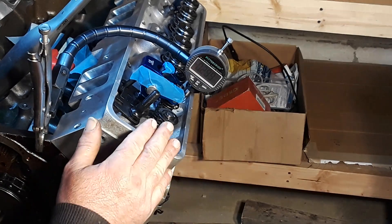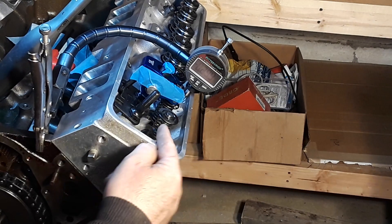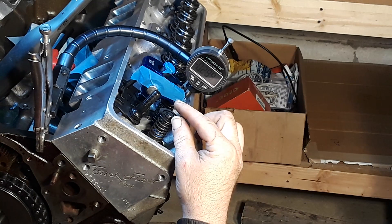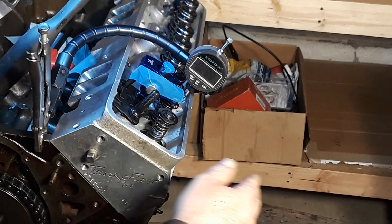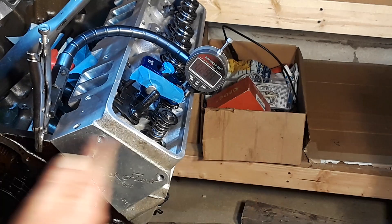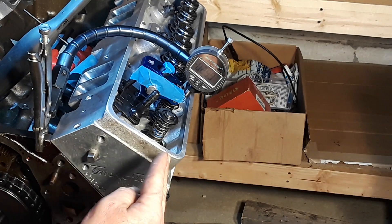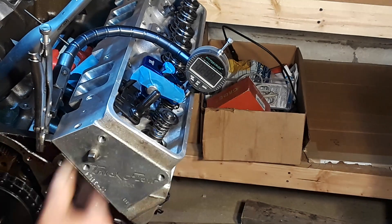Your goal is 50 thousandths. And if you can't achieve that, you can get away with 60. But if you can't achieve it, you have two choices: change the rocker arm manufacturer, or go with a longer valve stem. You can get longer valve stems that maintain your spring height. If you're too far out to the exhaust, you can get a taller valve stem that still has the keepers in the same location — that will bring you up and get you into the center a little bit more. You're going to be out past halfway — don't worry about it, as long as you're still in the meat. Two-thirds out, you're fine. But you do not want to be making a big sweep. We are at 60 thousandths of sweep, which is the max we want to do. It's out there toward you but we're still in the meat. If I was in the center sweeping 120, that's twice what it would be — and going back and forth, it's quite premature on the valve guide.